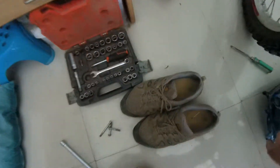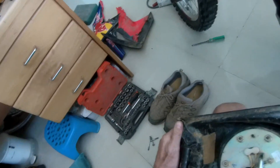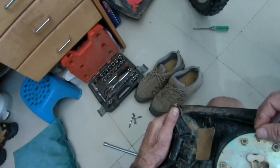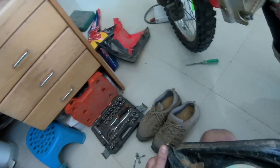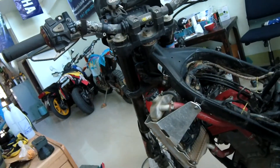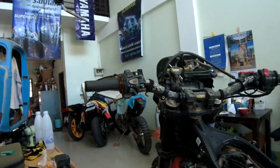That's my two faults taken care of. All I've got to do now is throw the fuel tank back on. While I've had the tank out, I've had the pump out too. Pretty much all you've got inside there is a big lump of white plastic with your fuel sender on it — it's a sealed unit. There must be some kind of filter in there but I tried to take it apart and it was proving difficult. The fuel that was in there and the tank looked clean — no crap or water floating around — so I've decided to leave sleeping dogs alone and put it all back in. All I've got to do now is bung the tank back on, put some gas in it, spark it up, see if it runs, then go back to the workshop manual and find out how to clear those codes.